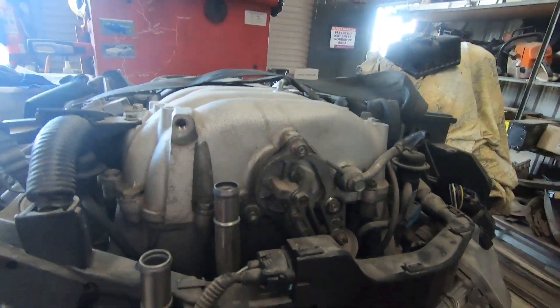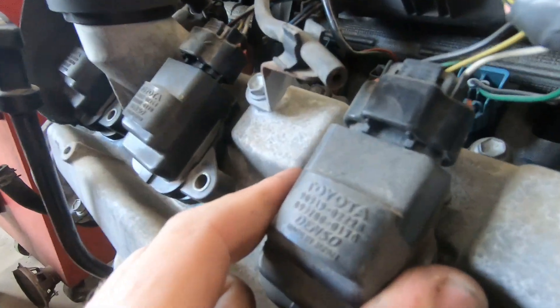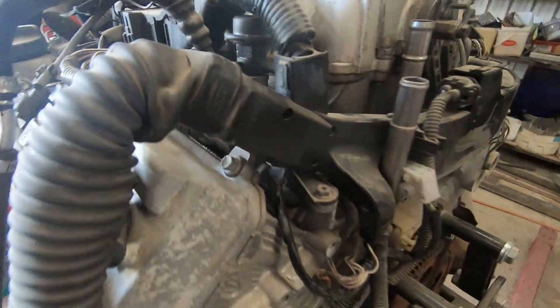I've got one motor that we're sitting on at the moment and that's set up to run. I do a lot of testing but I've started seeing a lot more of the 170 series 1UZ VVTI ECUs. All 1UZ ECUs are 89661 and then there's the part number. This is my early test motor — somewhere between 97 and 2000. It's got the big VVTI coils. They don't fit many other models, it's mainly just on these.